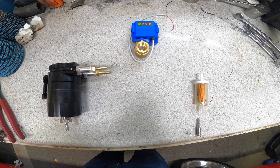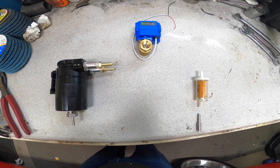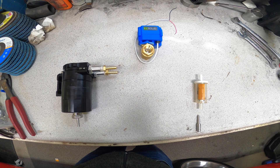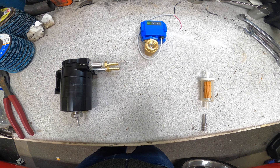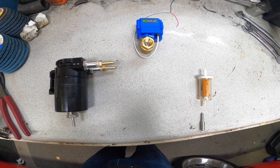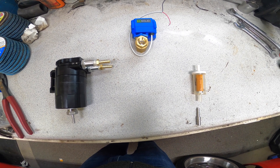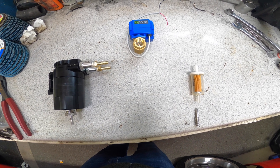This is for the fuel tank vapors. One issue I had with the FJ40 last time I went out is it has a vented gas cap, and on hard right, kind of off-camber areas of the track or the road, what would happen is gas would slosh towards the cap, and since it's a vented gas cap with a little bit of pressure in the tank, the gas would essentially spill out of the gas cap.